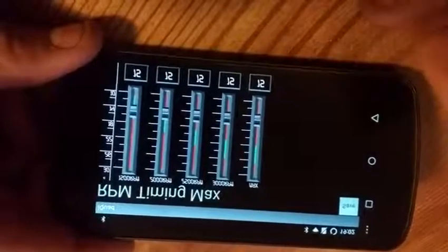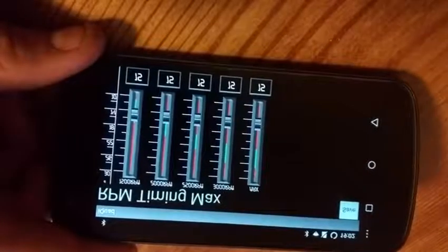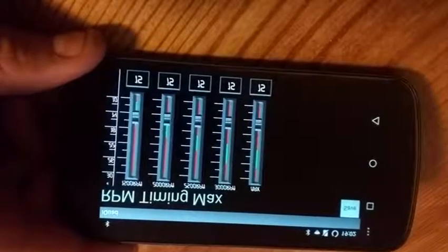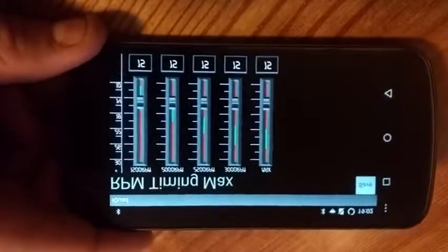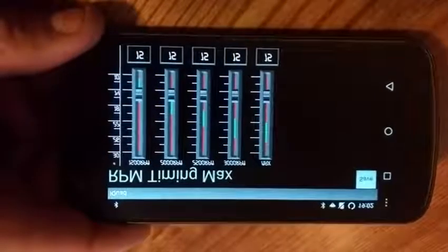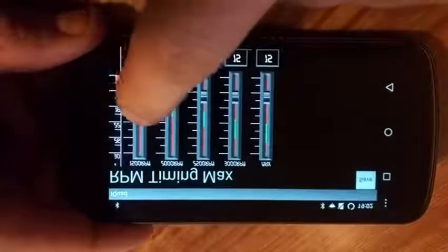That's where you can see the green lines inside the red. That's kind of what the typically accepted safe zone is for timing in our trucks. Again, you don't want to go outside of those zones unless you have a modified truck with studs and can handle the increased timing. So you can actually move these up and down.